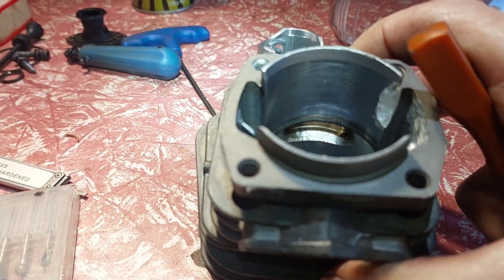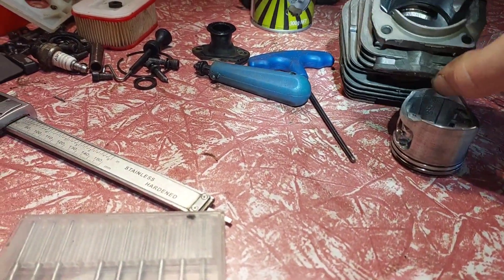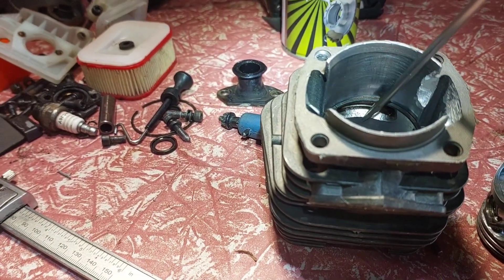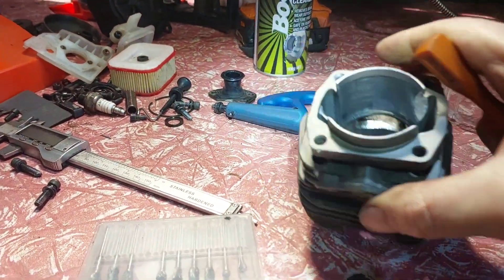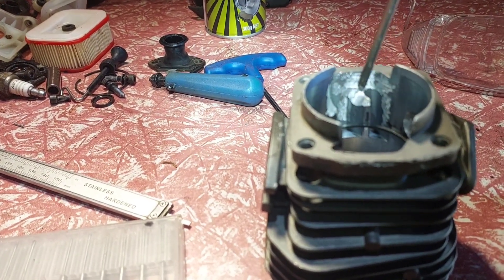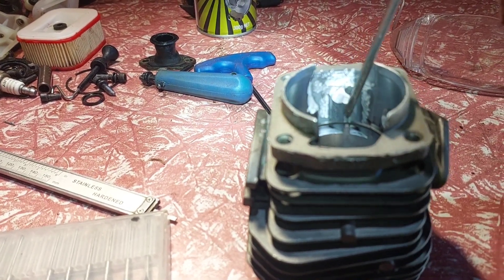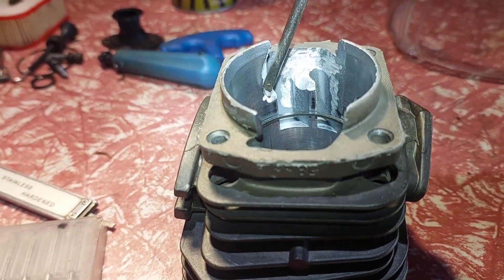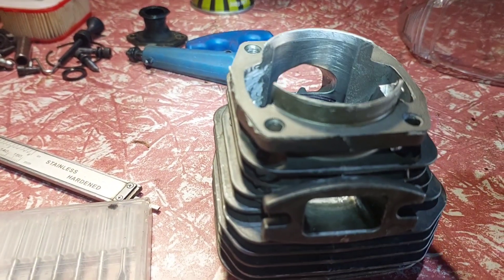I've also straightened out the exhaust because I looked down in it and noticed a little lump, so I've done some freehand porting on the face of that piece — just cleaned it up to make sure it's a nice arch. You don't want straight lines or your rings will get hung up. I've also removed the centre divider here — it's nowhere near where the rings will sit. The rings will still sit on fresh material here, so it's safe to rev hard, but with more airflow. Windows lined up with your transfers means more air.